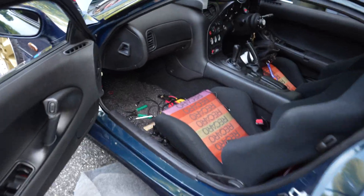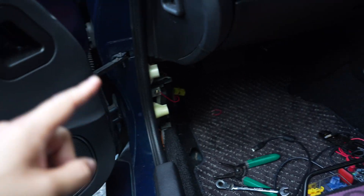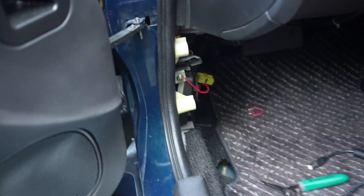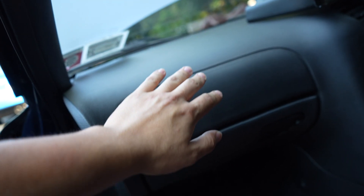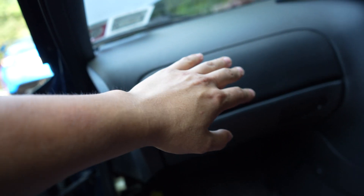We've got a pretty nice update. We bypassed the 1L directly to ground - that's the bottom wire right there - and that turns the compressor on. The AC right now is pretty cold, blowing like high 60s, low 70s. It's cold.